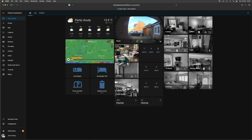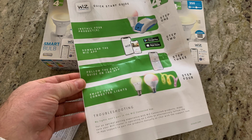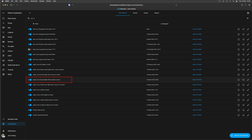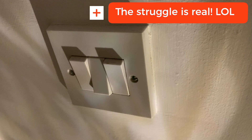A lot of what I've talked about is automation — performing tasks and actions without having to click buttons or open apps. These are the things we currently automate. A number of lights come on automatically 10 minutes before sunset, and the programme adjusts the timing each day as sunset changes throughout the year. Most of these lights are on smart plugs. However, the outside porch lights are LED GU10 bulbs from a company called WIZ — they're Wi-Fi operated and can be integrated into Home Assistant to work locally, no cloud required, triggered with the same automation as the other lights.